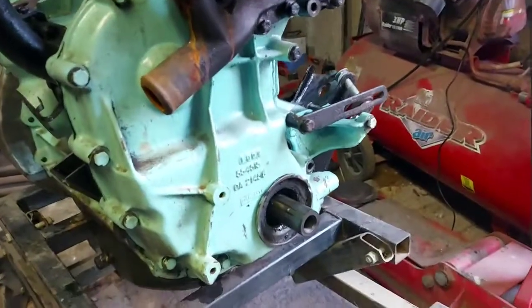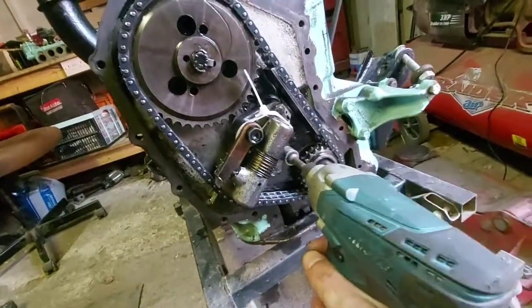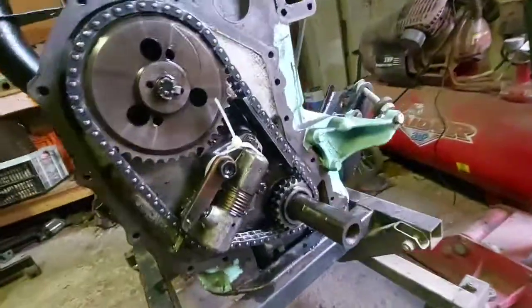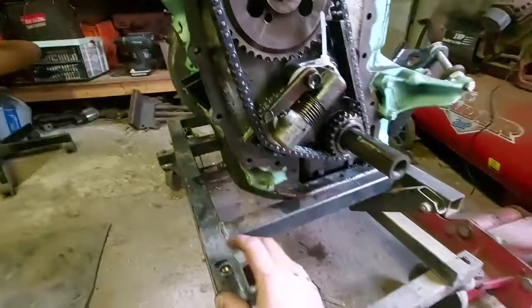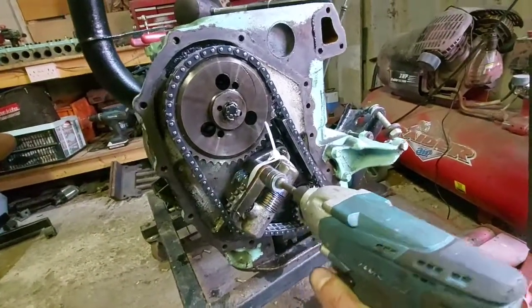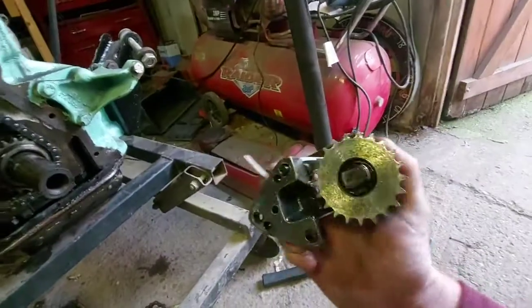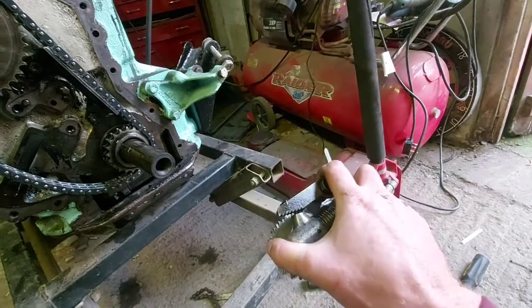I'll get this off and take it from there. I've put a tyre around there just to stop that from pinging out and exploding all over the floor. Wants to lift the tensioner out — just put that down there so it's not flying all over the place. Keep the bolts from one side. Sorry, I'm melting the floor here — I've really limited my space, it's killing me. You see that comes loose now. Just stop it from dropping. And that's it, that's your tensioner off. You can store that without losing everything. It will go a bit tight and a bit closer together, but let's put that on the bench.